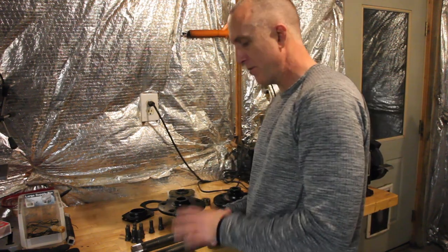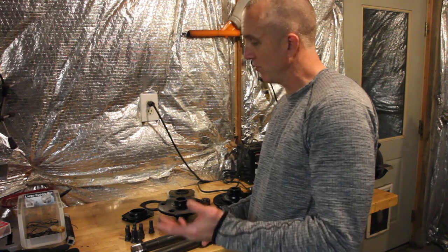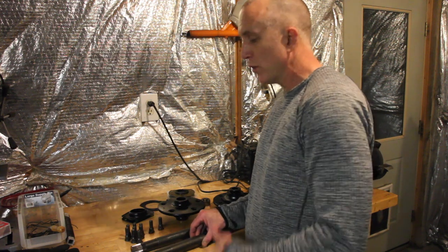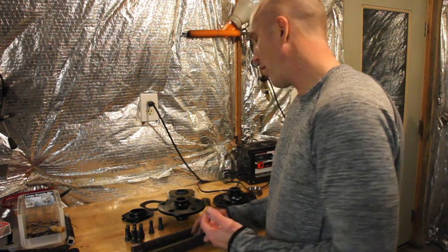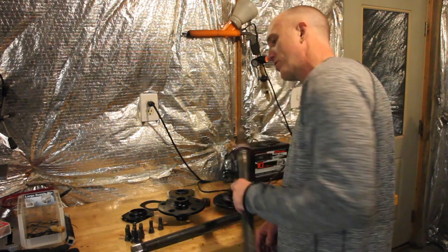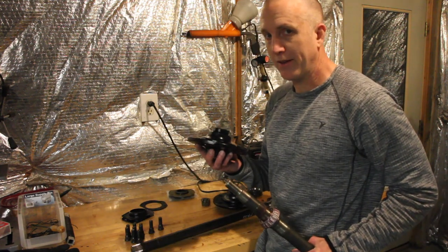The AMC20 is by no means one of the best axles on the market. It's really not all that great. The reason it's not all that great is because it's a two-part axle — meaning that the axle shaft and the hub are two completely separate pieces.